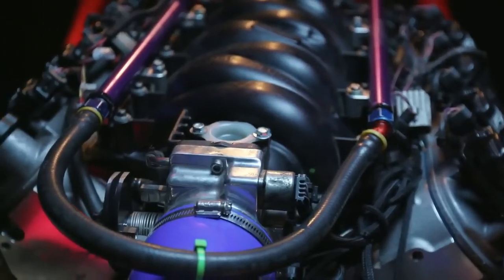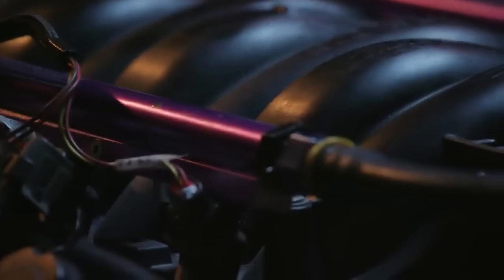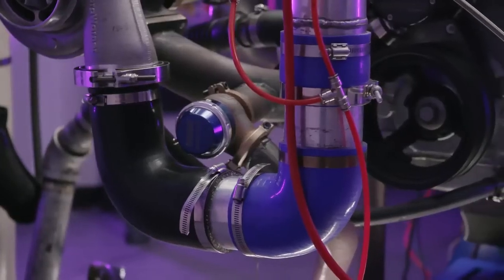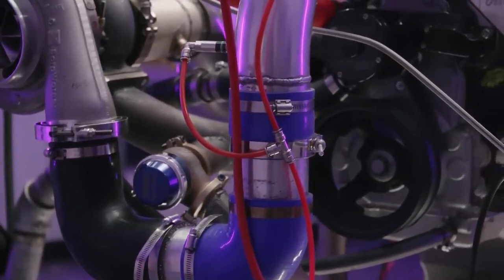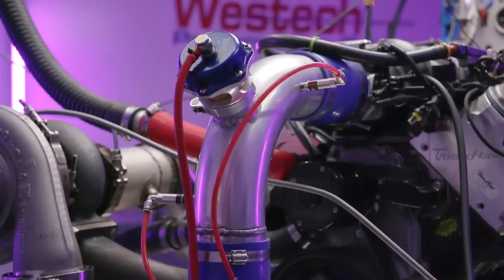That intake manifold doesn't work with meth injection. So you think it's a distribution problem? I think that if you look at what that manifold is doing in there with the plenum and all of those big log runners going around and everything, there's no way that water is getting from here to there. We are introducing a percentage of our fuel via the wet manifold flow path. Right. And that is affecting the tune, and then that would tend to indicate that the manifold is distributing that methanol to the cylinders. Not necessarily, because it's showing in the lambda. Yeah, but the lambda is picking up 4 tubes, and so what's the difference between the average of 4 tubes versus one of them being radically rich and 3 of them being radically lean?